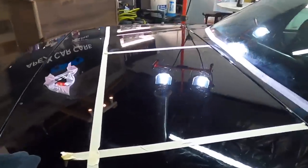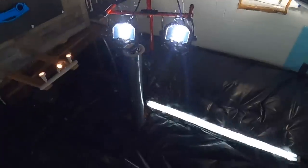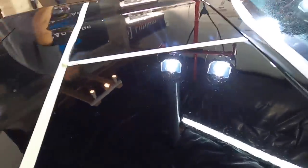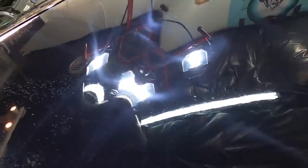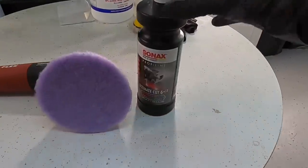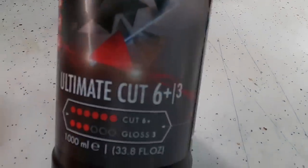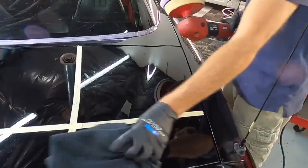With the residue removed, we can see that there's a lot less hazing but also a lot less cut was done with this pad. It's subjective — this pad and combination might have worked perfectly on a medium or soft clear coat, just not in this situation. It all depends on what you're working on and the conditions. Let's move on to the third section using Sonax Ultimate Cut Plus, teamed up with the purple Lake Country hybrid wool foam pad.